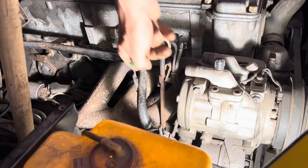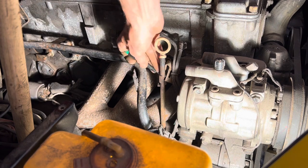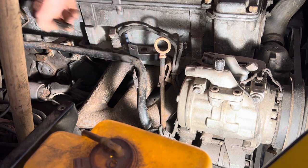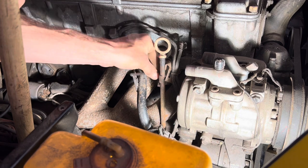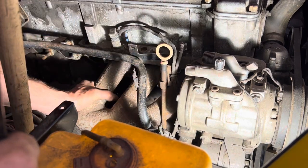Before you can get this out you have to take the oil dipstick off, and that is an allen bolt. It's important that you make sure that it's clean in there so you don't run the risk of stripping anything out. Of course it's inevitable that you'll drop that bolt under the car when you try and do that.